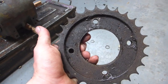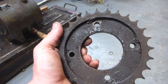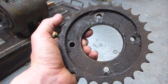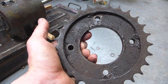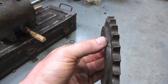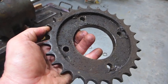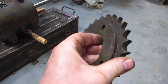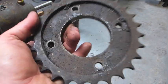The sprocket fits on the back of the clutch. The number of teeth is entirely standard — it's a standard three-quarter inch chain pitch. Sprockets are available in steps of how many teeth you want, and this is a normal number, but what's not normal is the profile — you've got a little step on one side but a recess on the other. So all I did was order a standard plate sprocket; there was some welding and machining involved, bits got chopped off one side and added to the other, and they've lasted really well.